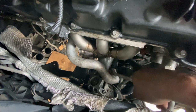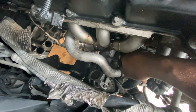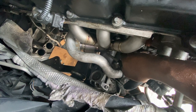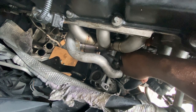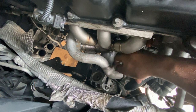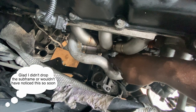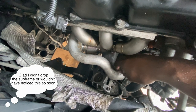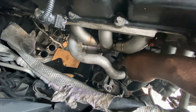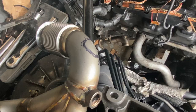When I was trying to put the mount on right here it pretty much wouldn't be able to go in. So either the manifold has to get notched or the manifold has to get shaved down some. I'm gonna use a Sharpie marking around where it's hitting on both sides — the header and the manifold — so either I'm gonna shave it down some or notch the header. I'm gonna see what my options are.